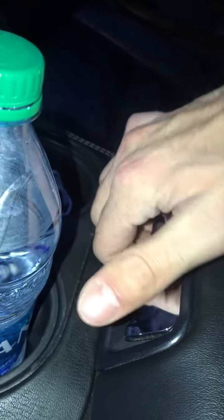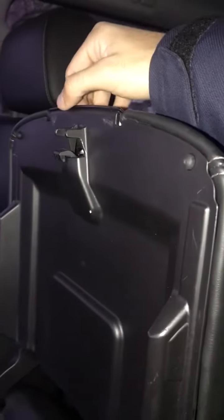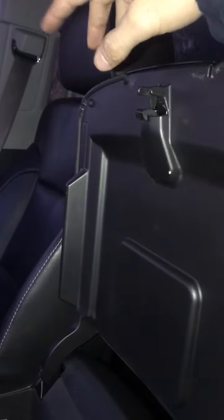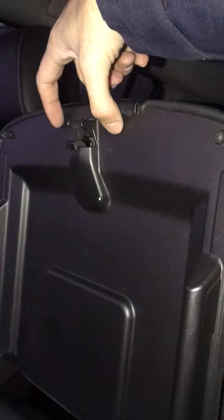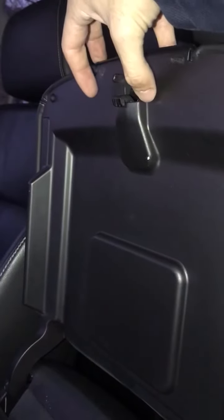Putting my two fingers on the black plastic. To remove this panel there are clips: one here, one here, one here, one in the middle, one here, one here, and one down here. Pull this thing out. There are three bolts for the armrest latch — one here, one right here on the other side, and one right under there. Take them out, replace that thing, put the bolts back in, and press this panel back.